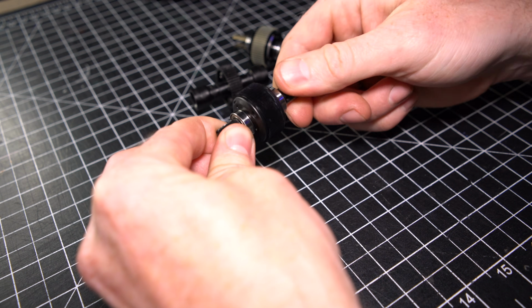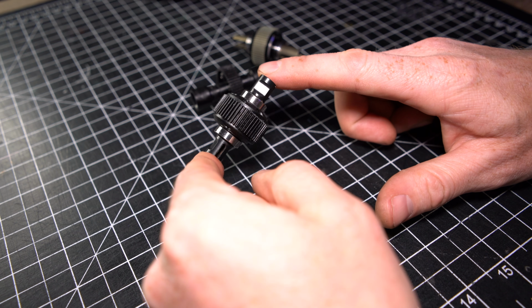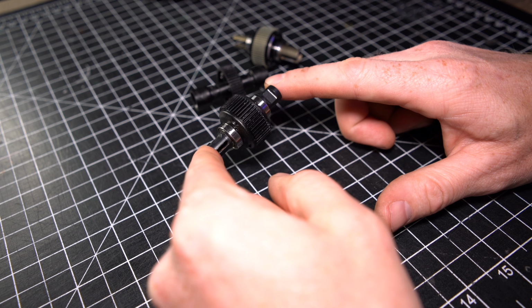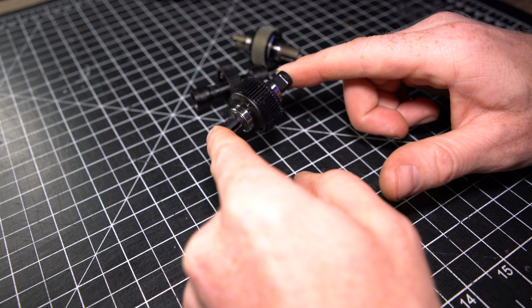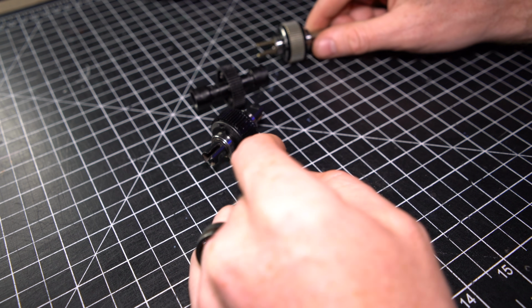I have this one set up pretty stiff with the stock Yokomo 7000 weight. My plan is to run that Yokomo RD2 as an outside car, so I tend to keep this one a little stiffer than what I keep my CLSD at.